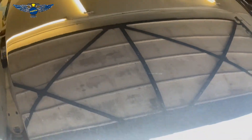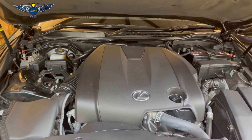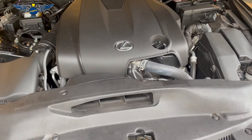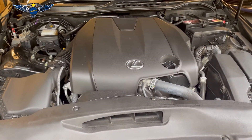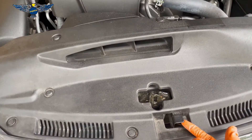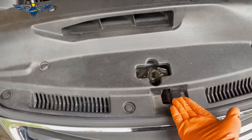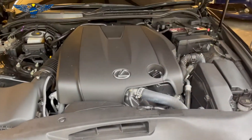To change the battery we need to get access to the engine bay here, so get your bonnet open. There is a lever inside of the car you pull to release the bonnet, and then you put your fingers under the bonnet and just move that little flap there to get the bonnet open.